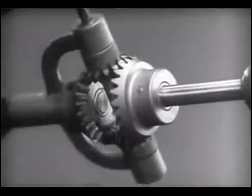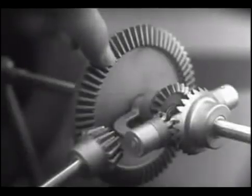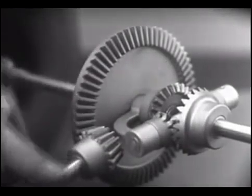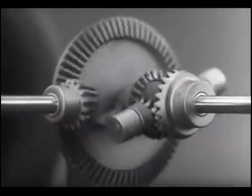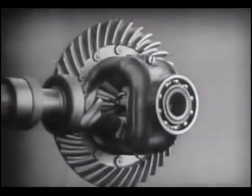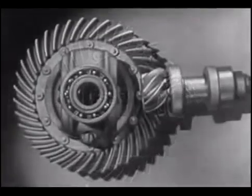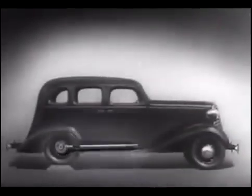In order to turn the support and drive the wheels, we can fasten a large gear here, connected by a smaller gear to a source of power. Notice that the power is connected to the differential at the center line. We can make our model more compact by moving the gears closer together. When we put our differential in an automobile, we have to leave room for the drive shaft which carries the power from the engine.